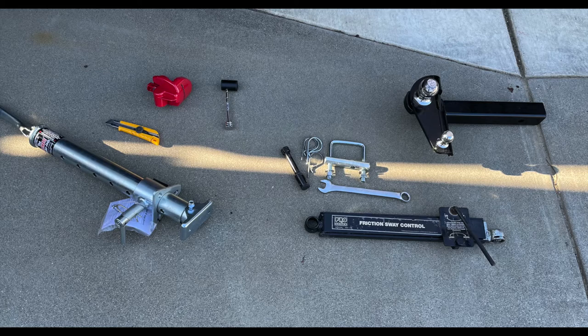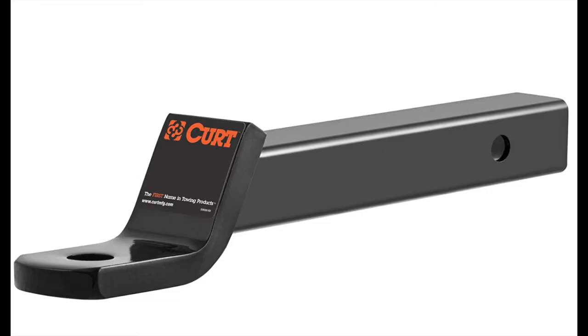Mine's just a little bit different than what I'll show you for the options you might want to get — I already had the sway bar, so I just had to add the brackets to the A-frame and the platform to the trailer hitch itself. It took me a while to find this trailer hitch that was 13 inches from the pin to the ball coming out under the Jeep Wrangler, but I finally found one. I'll have links to all these products below. It wasn't sticking out too far and wasn't too far in — I can still do turns adequately without touching the tire.